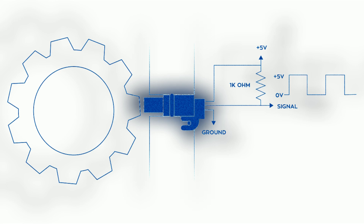There are also a couple of teeth missing on the tone ring, which serves as a reference point for the sensor and ECU. Using this information, the ECU knows exactly when and which injector to open. And by cross-referencing the camshaft position sensor information with that of the crankshaft position sensor, the ECU knows if there is a problem with timing and whether or not the crankshaft and camshaft are out of sync.